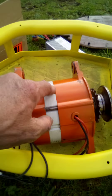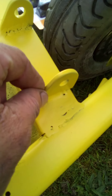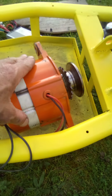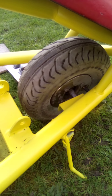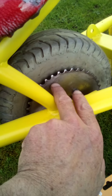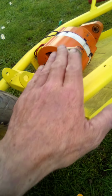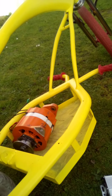Here's Nemo — still orange and white, and we're going to fit it in over here somewhere. I did have to cut out the old motor mounts and I put in new motor mounts here to fit this motor and to make sure it was in line with the sprocket. I actually had to make a tool — it's like a ruler so I can straight edge from this to the motor sprocket and make sure they're both in line. It was a neat, very handy tool, easy to make.